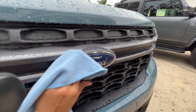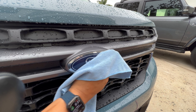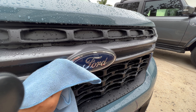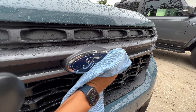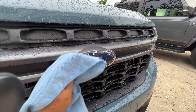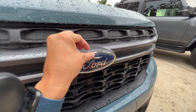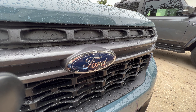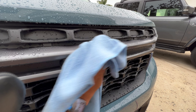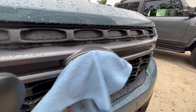The vinyl will react differently and adhesive really just doesn't work that well at cold temperatures. I've bought phone mounts and they install with 3M double-sided tape and they don't seem to stick at all at 40 degrees. And once you compress the adhesive, it won't really work that well even when it does get warm. So you want to do this in a heated garage at a minimum. Try to get everything up between 70 to 80 degrees. And once you install it, don't run out into 20-degree weather, and don't go to a car wash and have high pressure hit that very brittle vinyl — it will probably tear it in half.